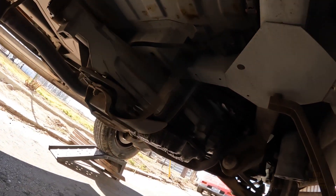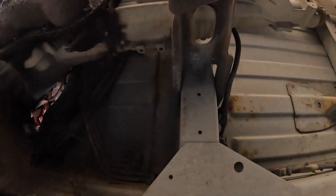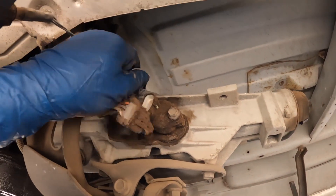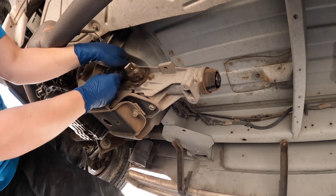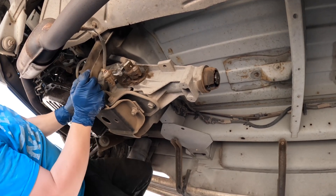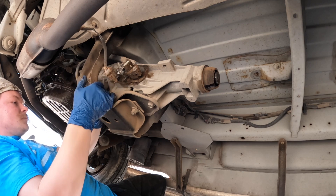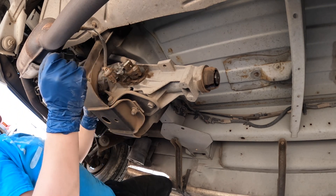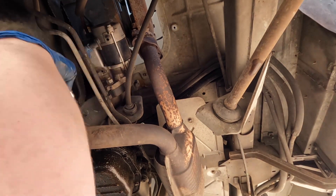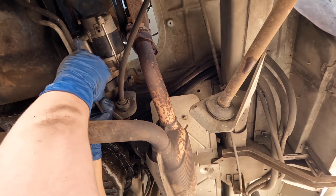At this point I'm going to start disconnecting all the wire harnesses and also disconnect the trans cooler lines. I'll need a pick for that one — the tab broke up. Looks like to get to this connector you have to remove the trans cross member. I've disconnected the battery. Let's go ahead and get the starter out of the way. There's a clip holding the trans cooler lines — we'll leave those on the line so we know where they go.